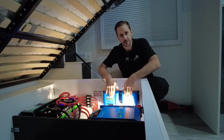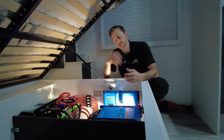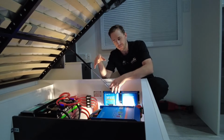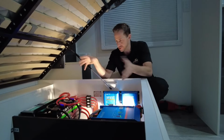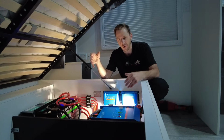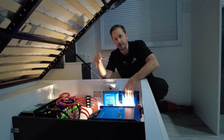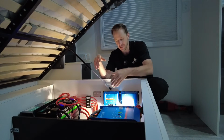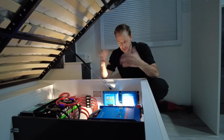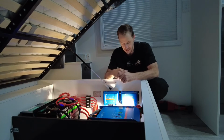So we're running the 40 volt strings on these, so we're running a higher voltage string just to get more out of the day earlier on in the day and obviously late in the afternoon. Having that higher voltage into each of these controllers allows them to function better really early. So this is charging at 13, 14 volts. When you run a parallel system and you're only at that sort of 18 volt range, there's not much of a window of opportunity for the MPPT tracker to do its job properly. When you increase that voltage, it's got more window space to work with. So you just get a better yield over the day. And the proof's in the pudding, you can log on to each controller to see the yield with a history with each of that.